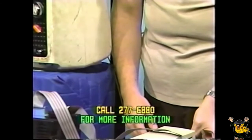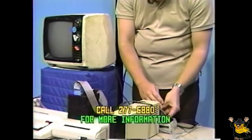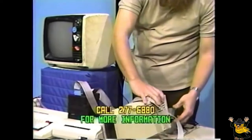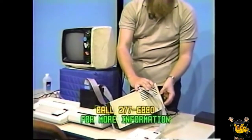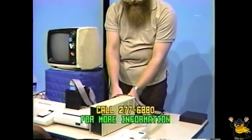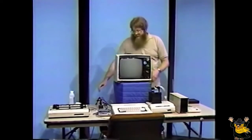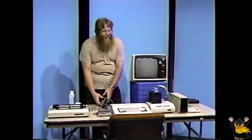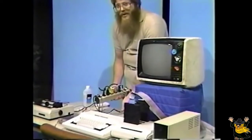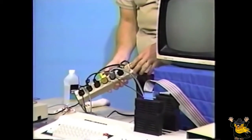Take the exact same cable and attach it with the equivalent of pin 1 to the back of the disk drive where the connector is available. Make sure at this point that the disk drive is also off. Now, plug all computer-related items into the multi-outlet strip. Make sure all the connections on all the cables are nice and tight, then activate the power switch.